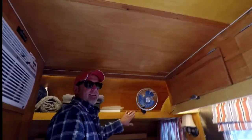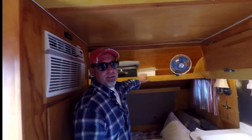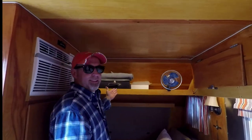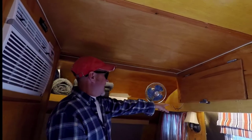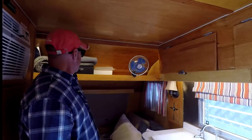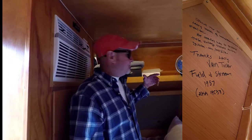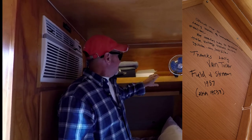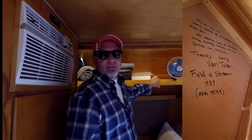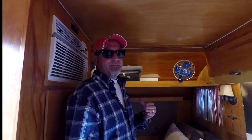Now here — this is something I put in that didn't come with the trailer originally. It just seemed like dead space, so I tapped into the struts, the verticals there. It's kind of like a honeycomb in a grid sandwiched between eighth-inch birch — it's a sandwich board, very rigid and solid but very light.